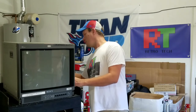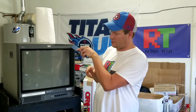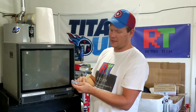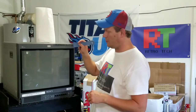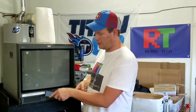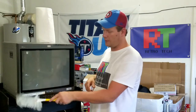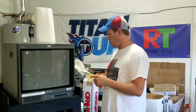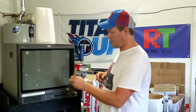Some of the tools you might need: I'm going to use mostly paper towels, but for some of these stickers I might need to scrape, so I'll use a plastic putty knife — it has an edge so you can push along the sticker, put some cleaner there to soak in, and then scrape it off. For dusting I like to use Swiffer dusters to get rid of a lot of the dust to begin with. It does a good job capturing dust along with the compressed air, and a paint brush can do a good job getting into corners without doing any damage — nice soft bristles.